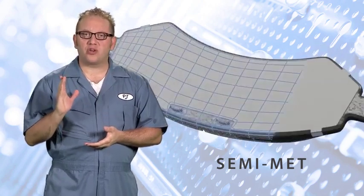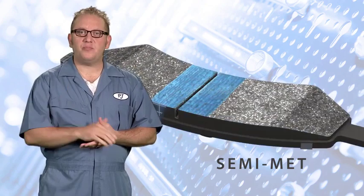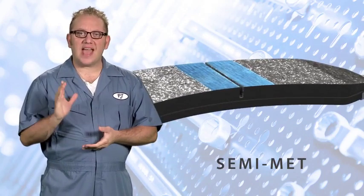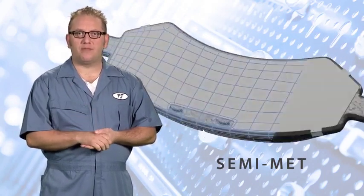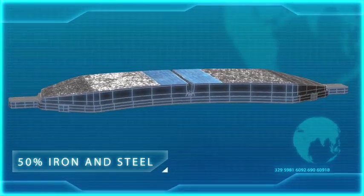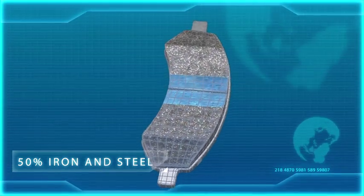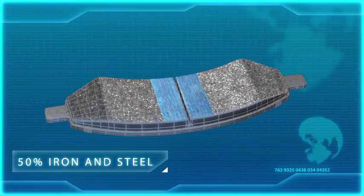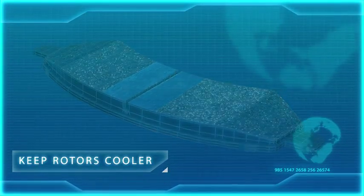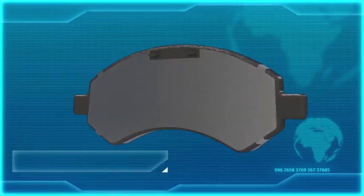These workhorse pads are the go-to for towing heavy loads and heavy driving. Longevity and durability — even under extreme conditions, these pads can last up to 40,000 miles. Beyond that, these pads have built a solid reputation for excellent pedal feel and trouble-free stopping performance. Semi-mets contain more than 50% iron and steel by weight, and also have high levels of graphite combined with petroleum coke. Semi-mets promote heat transfer and will keep rotors cooler. Unlike organic pads, these metal-based pads will give your customers excellent friction and wear properties at extremely high temperatures.